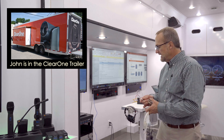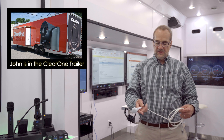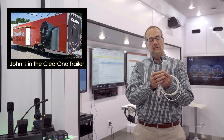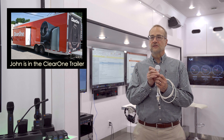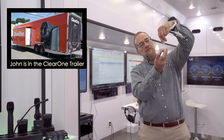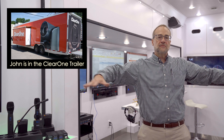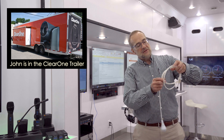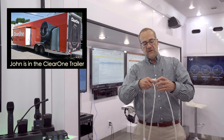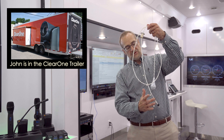So we said, let's add a different, improved one. We put in all new electronics including new microphone elements. We added LEDs to show whether your system is on or in a muted state, and we moved those microphone elements into this windscreen that bumps out here — now it picks up from a much broader area. To make it easy to install, we have a seven-foot cable with a cinch ring, so we can adjust it from zero to seven feet. A lot easier than the previous one.